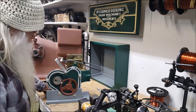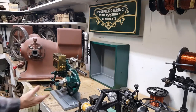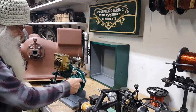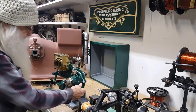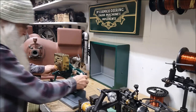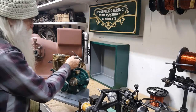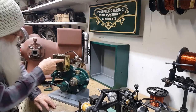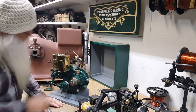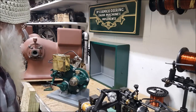That works — what makes a perfect little EK test stand — and we're gonna pair it up here with that electric drill right there. I've already got the correct amount of shims in there, got grease in the fittings, oiled everything, and it's in a bracket with a good ground. That's one of them test plugs right there, and that's a quarter of an inch from that plug over to the side right there. It's way too much; I shouldn't be doing it, but for test purposes I think it's all right.